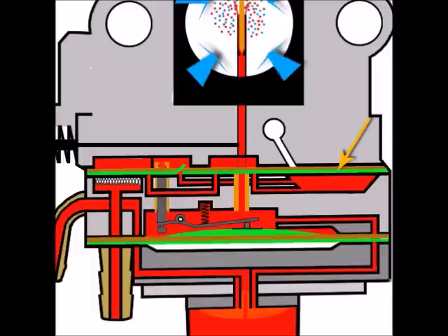This specific area of the diaphragm is compartmentalized by a special gasket above, and it moves up and down in a pumping action. In real life it moves much faster than this — in fact, it moves as fast as the piston moves up and down inside the engine, and I'll explain how that comes about shortly.